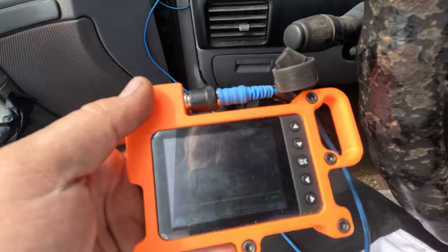I'm pushing it pretty hard and nothing is causing it to stall. I'm going to call this a fix — it was just the dirty connector. All it was, was a bad connector at the ignition control module.